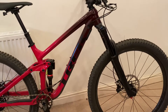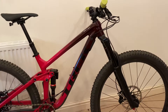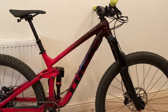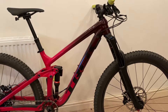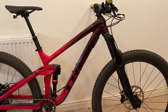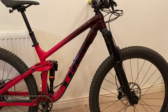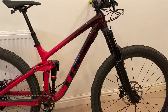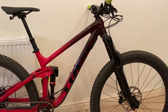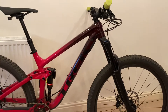The Yari forks might not be top of the range but they're doing a great job for me. I will be upgrading the air spring — RockShox have brought out a new one for the Lyric Ultimate this year that should help the bike sit a bit higher in its travel and be plusher at the top. With the current Debonair spring you can actually pull the stanchion up slightly, suggesting it's sitting a touch low, so that upgrade should address it.